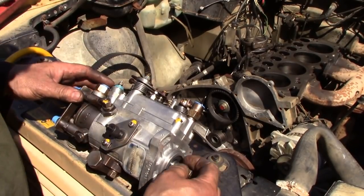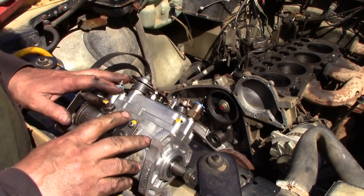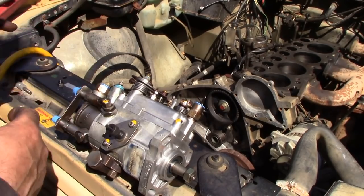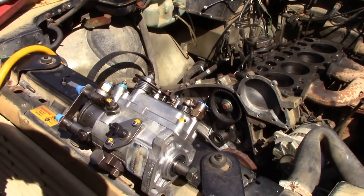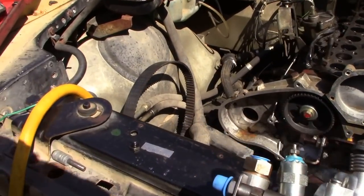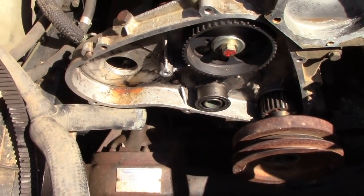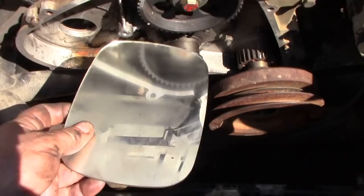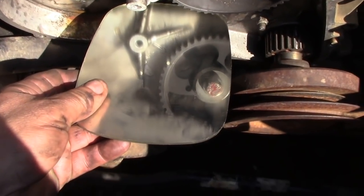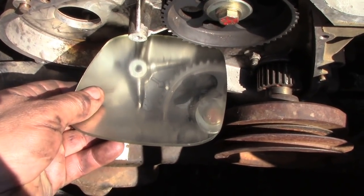These pumps are on slots, so we don't know where the firing stroke is. What we're going to do is take this little plug on the side of the pump, and using this little tool from this red box of timing pins for Land Rovers, we can screw that in and turn the pump until it locks — and that's locked up. We won't take that out, leaving that as it is. Now I'll show you a little tip on lining up the timing marks because they are quite difficult to see.